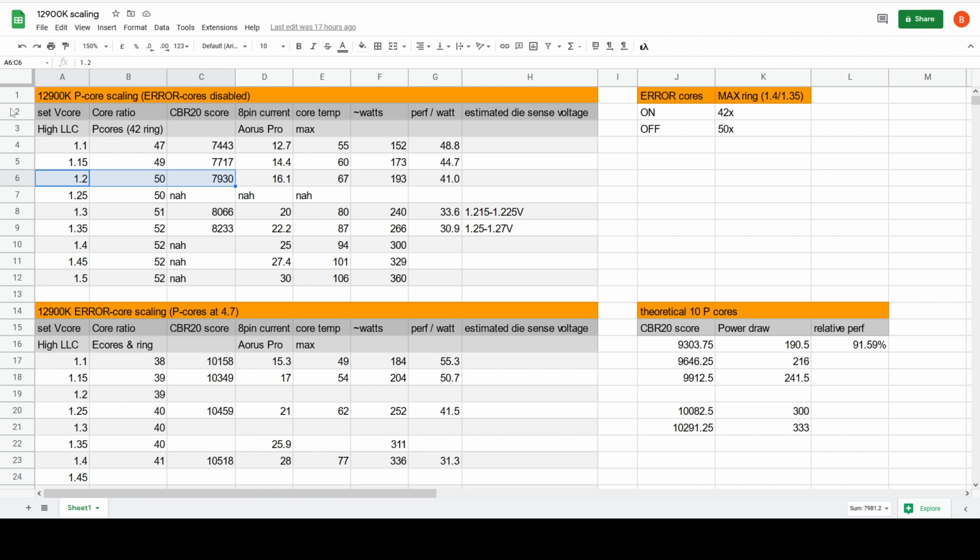I don't know, on one hand, that's not really going to hurt you that much just because the P-cores are so insanely fast. On the other hand, I'm not sure that you... The funny thing is, the stock behavior of the CPU is actually really bad in terms of how much extra voltage it runs on, which is normal. CPUs and GPUs from the factory come with a whole bunch of extra voltage for the sake of maintaining stability, even on the world's crappiest motherboards and power supplies.